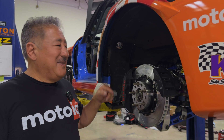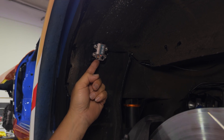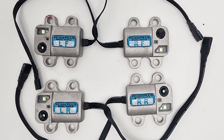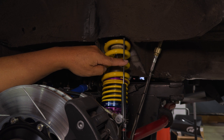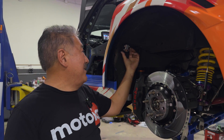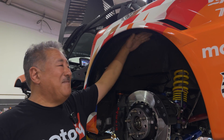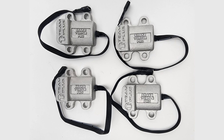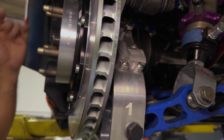There are two sensors installed underneath the car. One is the tire temperature sensor — it has a broad coverage infrared sensor with a camera that helps you aim it. This thing is really easy to install; we have it mounted in the wheel well. We have shock pots here so we don't need the wheel position function, but if we wanted to log suspension position, we'd mount the sensor up higher. We also have another sensor mounted right here that monitors the brake rotor temperature.